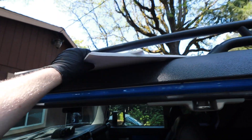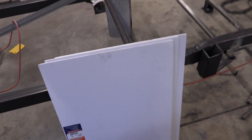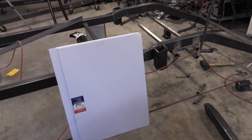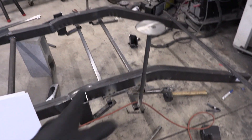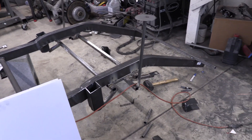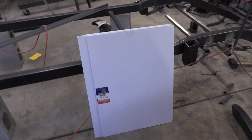Okay, now it's time to hit the shop. Let's get down to work making some strut towers. Where are my arts and crafts supplies? I bought these things - they're pretty big and they're to make templates out of. I cannot believe that I lost them. I finally found them - they were on top of the roof. This is foam core, or foam board. It's like cardboard but it holds its shape a little bit better, it's a lot straighter, and tape sticks to it really nicely. I'm gonna build the strut tower structure out of this first, then use those as templated pieces before we cut the metal. The game plan is a three-sided pyramid kind of shape - up here, up here, down there, flat piece on top. I've seen it work on other vehicles and I think it's gonna be a good shape for this one.